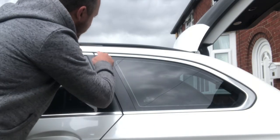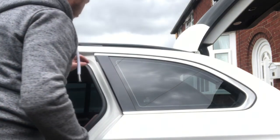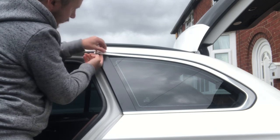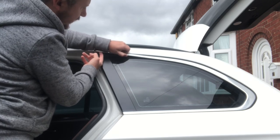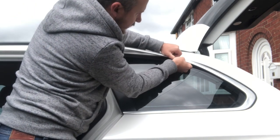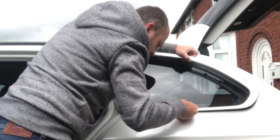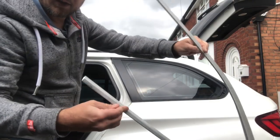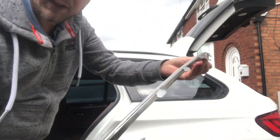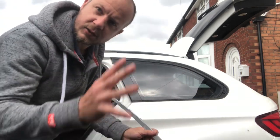So this trim here is just pressed into place. If you open the rear door and get your thumb just behind the top part of the trim and pull it straight out — you see it's already coming off? Don't bend it, just be careful. It's just got a bunch of locators that hold it in place. And it's off. You can also see how dirty the locators are that get behind it, so it'll need a real good cleanup. We can paint this with Plasti Dip off the car, clean up the rubber seals, and it should go on real nice again.